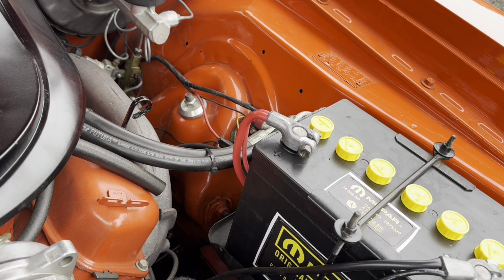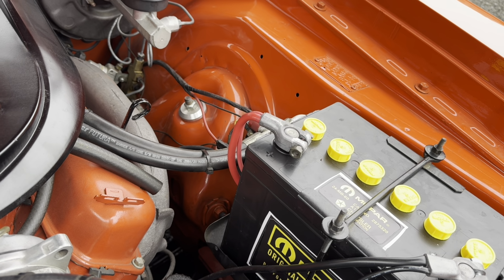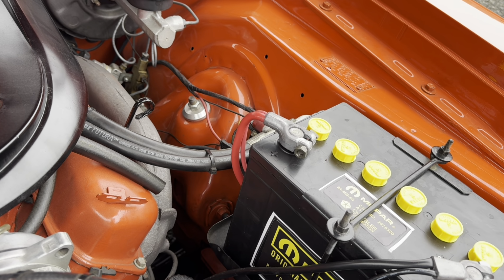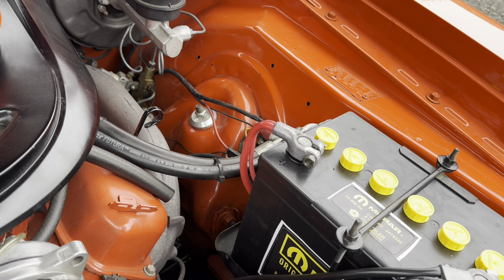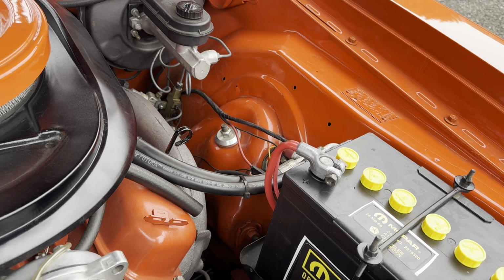So basically the premise of this is it's coilovers and rack and pinion. But the problem is they put the coilovers to the shock tower, and the shock tower is not meant to take that kind of load. I'm actually kind of half expecting to find some damage on there when we take this all apart.